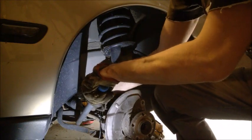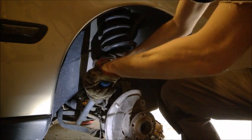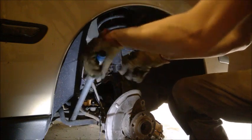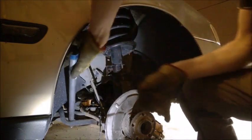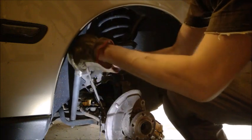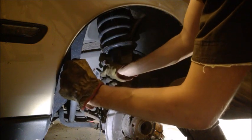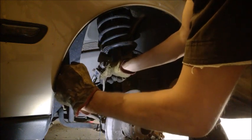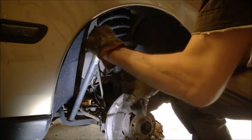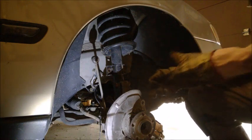Just twist the ball joint a little bit and it comes out. When you place it back, you notice how it stays up. Basically just press down in between the anti-roll bar, sway bar, and the bushing, and just bring this guy back to match it with the hole — otherwise you won't make it. Alright, thanks for watching. I'm really tired, still working on this thing.